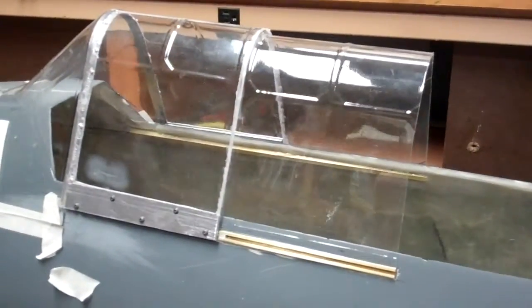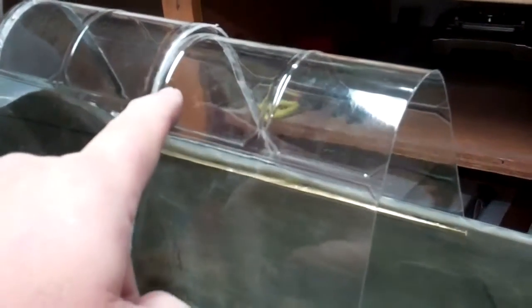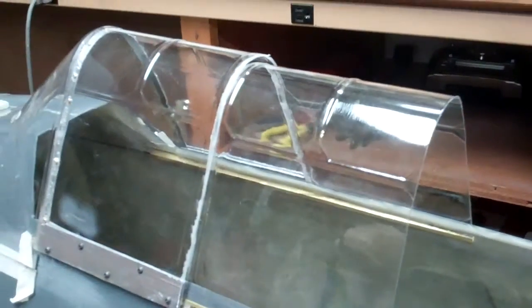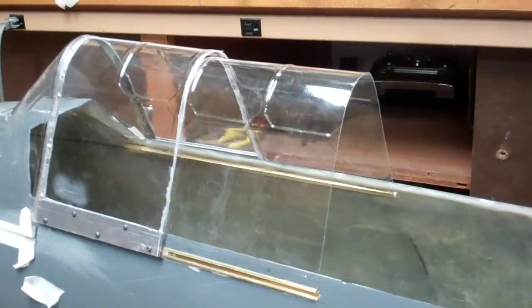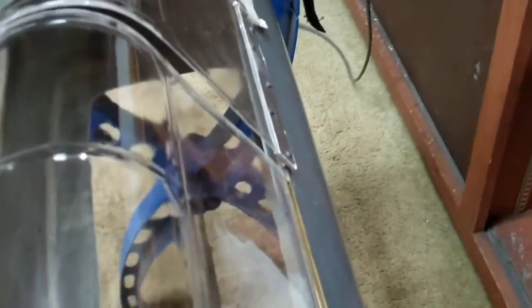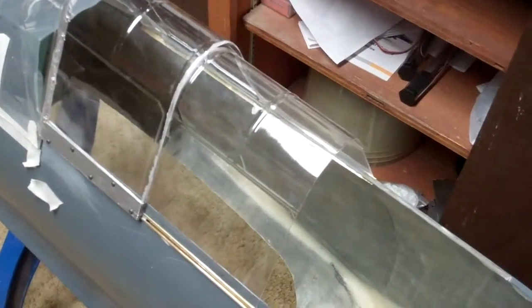Welcome back. We have the center section cut down to shape. We took probably just a little more than three-sixteenths of an inch off of each side to get enough of a gap so that the screws will fit underneath, and when you actuate the canopy the front slider slides completely over top of the stationary inner piece. Now what we need to do with the stationary inner piece is get the stiffener in the front air dam area in here — that's what will hold its shape so that your gaps are even all the way around. Once we get that done, we'll get it bolted on with the double-zero wood screws, and then we'll move on to getting the rest of the railings in.